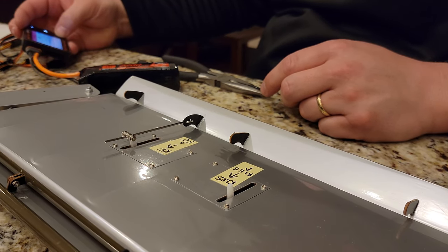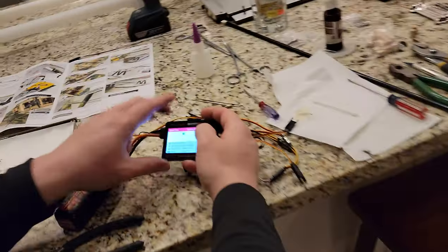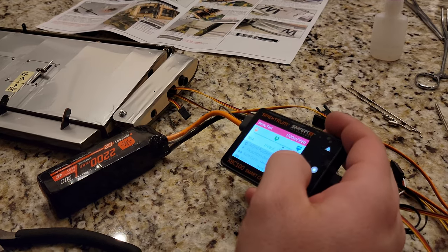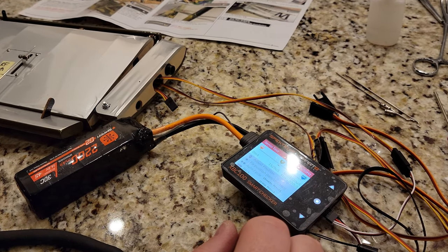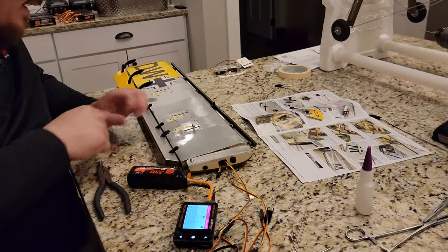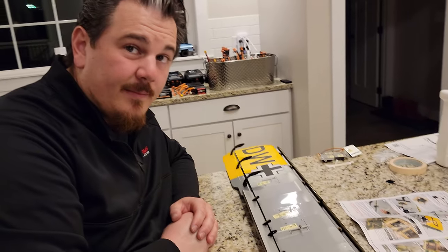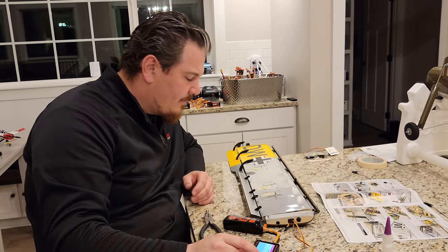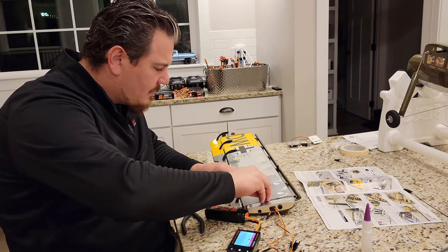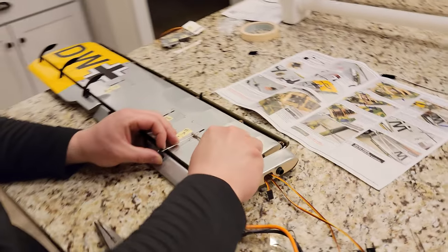Going to the sweep. Ooh, that's not good. Still bound pretty early. Okay, so what I want to do is see if there's another way to fix that bind, because that bind could be pretty bad, actually. So my thought is to go to the max position and actually make the servo go up a little bit. I want to try something.